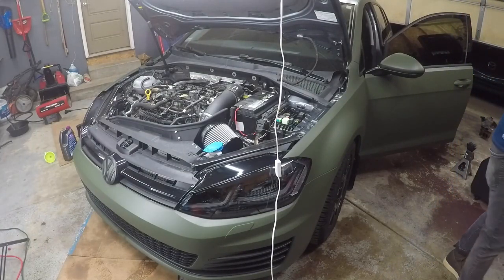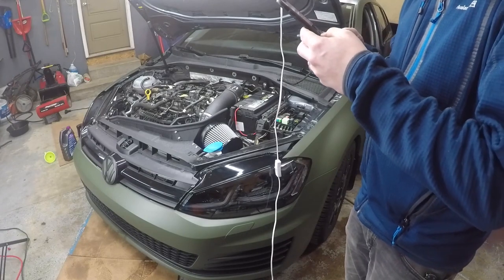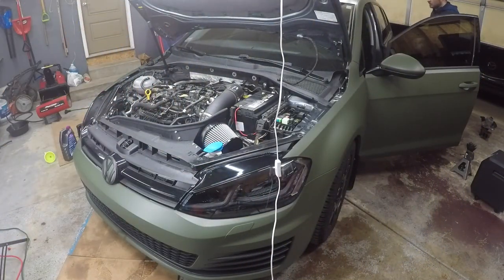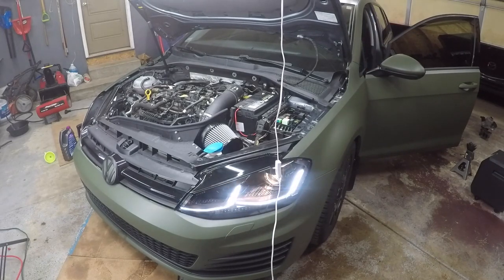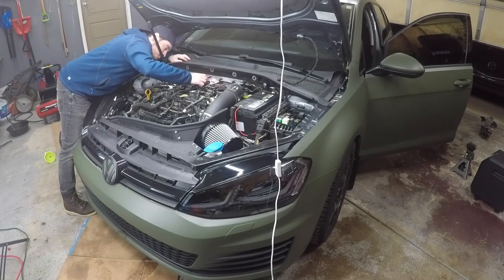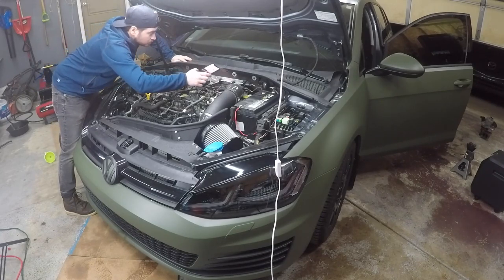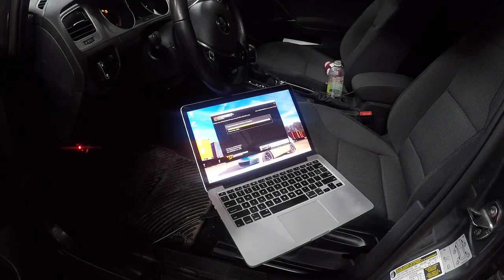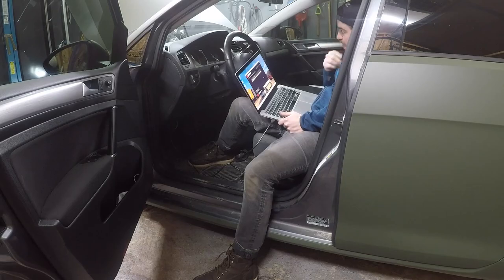Reinstall the intake and make sure you connect the secondary air intake as well as the vacuum hose underneath it. I missed capturing one step on film — I pulled the fuse for the fuel pump so I could turn the engine over for about 10 seconds to get coolant and oil running to the turbo. Now the moment of truth — I'm going to start the car for just a short period of time. I ran it for about 10 seconds and checked to make sure there isn't any coolant or oil leaking from the spots we'd been working on. Now that the turbo install is complete, I'm running Unitronic Stage 2 Plus IS38 to flash the ECU and configure everything.